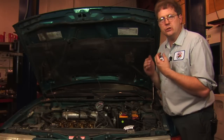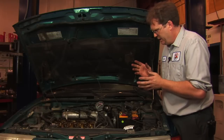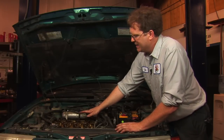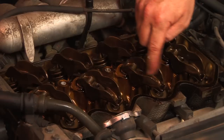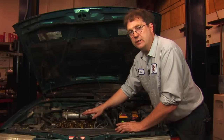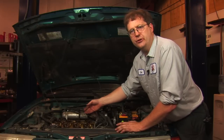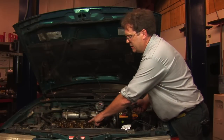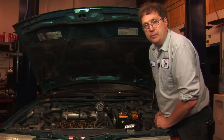The next thing we can do is look for evidence that the camshaft turns. The camshaft, directly or indirectly, is responsible for opening and closing the valves in an engine. We've actually removed the valve cover on this engine, and while we cannot see the camshaft itself, it's located underneath where these rocker arms are, and the valves can be seen with their springs right across the front of the engine. One of the signs we look for is whether the valves operate — you can often see the rocker arms through the oil fill hole. When we crank the engine over, we watch to see if the rocker arms actually move. And they do — so that's a pretty good indication that the timing belt has not broken on this car.